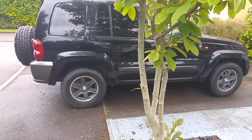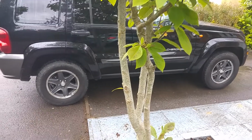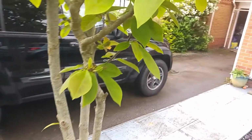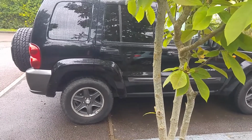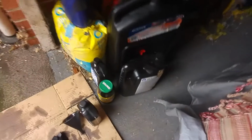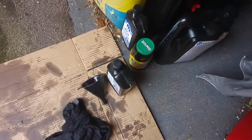So I'm back off road test, and I had to put all 7 litres of oil into the gearbox. I'd put 6 litres in. The driveway is very slightly sloped, like most driveways, and the dipstick was indicating that it was overfilled, even though I'd only put 6 litres in. So what I did was to basically get the used oil and fill it back into the old bottles.